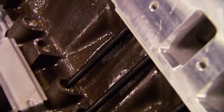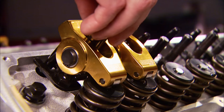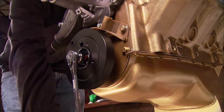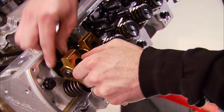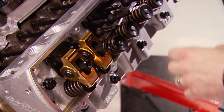We can drop in our push rods — remember to clean them up before you do this. For rockers, we're using Comp's Aluminum Ultra Golds with a 1.6 ratio. To adjust them, work one cylinder at a time with each lifter on the base circle of the cam. Tighten the polylock until you get all the slack out with a little bit of resistance — now you're at zero lash. Then turn the polylock just under a half turn, tighten the set screw, and use the T-handle to lock them down into place. This gives you the ideal preload of the rocker arm, push rod, and lifter. All you really need is a wrench and an Allen.